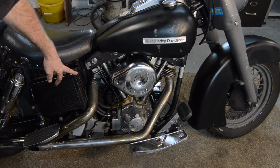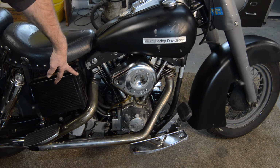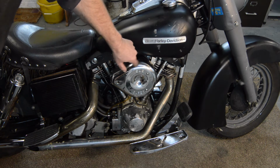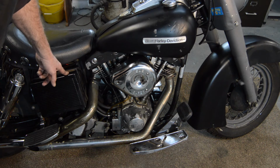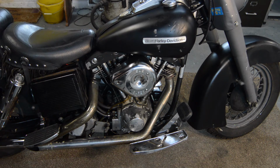Battery box, I assume. There's no obvious signs of any major issues looking at it. It's not pouring oil out of anywhere. There's slight dampness around the heads perhaps, but not a lot. The exhausts appear to be slash cut straight through, so I'll have to poke something up them, see if there's any baffles in there.